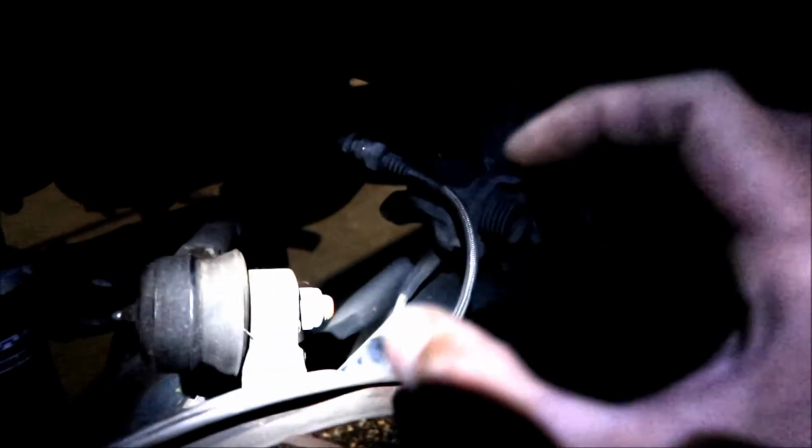Man, I'm telling you, the 1G suspension sucks, dude. At least a 1G all-wheel drive, you know. I tell you, I could take a sway bar out of a front-wheel drive 2nd gen easily, like within an hour. But yeah, it was really hard to get to the bolts in the back, and at some point I had to use the open end to get it out because I think this is an aftermarket sway bar. It's an oversized one, so there's not a lot of room to move the wrench around, man. Yeah, what a pain in the ass. So, okay, the other side I still gotta take out the bolts. Hopefully the sway bar will come out nicely, and hopefully it'll go back in nicely too.